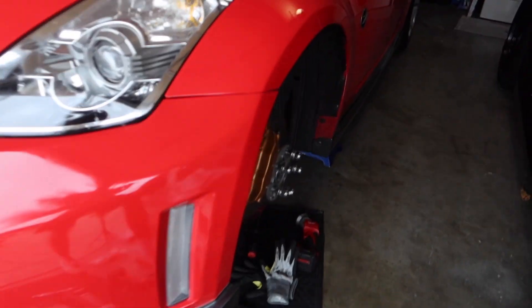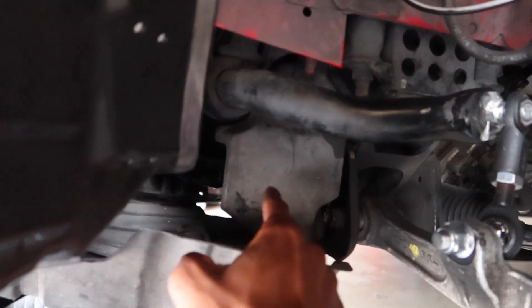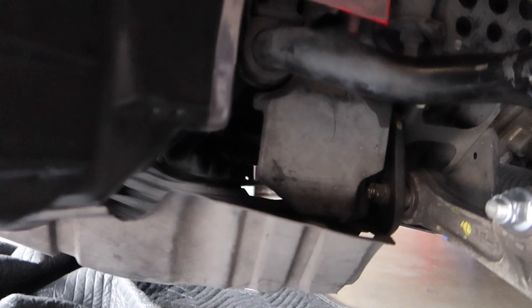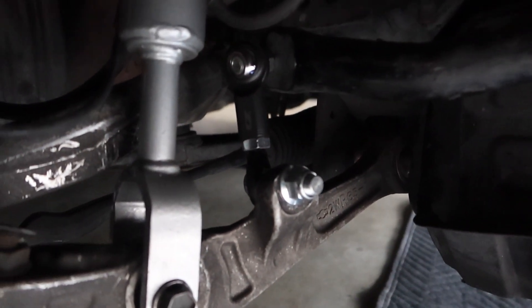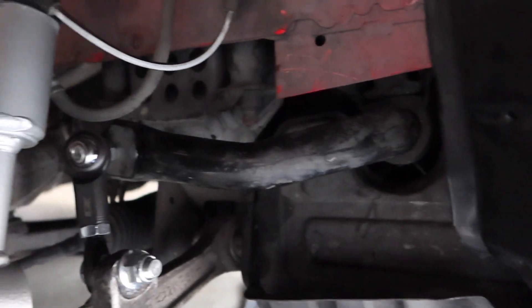And just like that, we are finished. I went ahead and put the sway bar back up there. I ended up clipping this panel down properly — there's a clip here and a clip on the underside — and tied my under tray back down even more properly. Same thing on the other side, there's another panel I tied down correctly. I got the sway bar back in and I have the end links on. They're adjustable. That side is actually a lot longer than this one, so I definitely need to get an alignment on this car. I'm just happy that the sway bar is now connected and everything is back together how it's supposed to be.